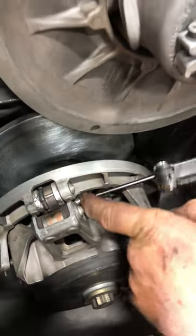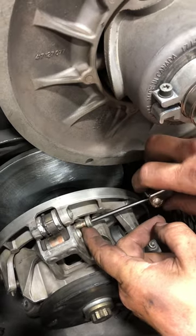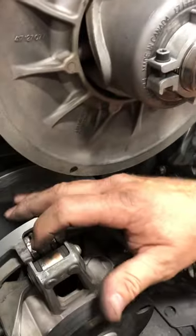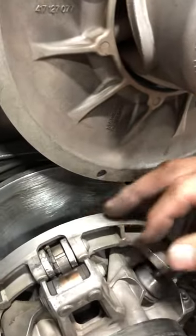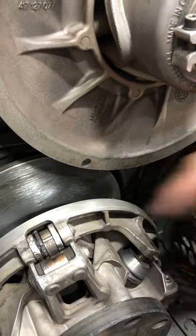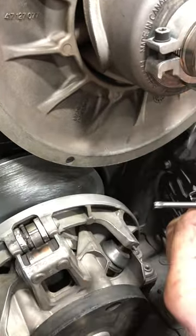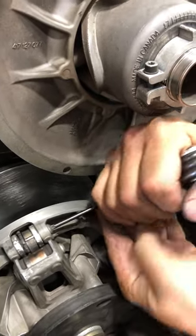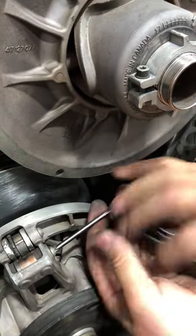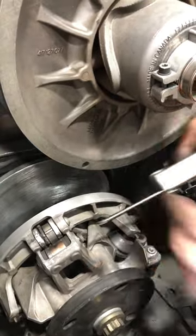Continuing to take the clutch apart for cleaning, we'll remove the weight bolt. Once we remove that weight bolt, you only need to loosen it to change the cam adjustment clicker. But if we want to clean it further, we'll pull the bolt all the way out, which makes it easier to remove everything else. We'll loosen both bolts, removing them so we have a little gap between there and the stop.